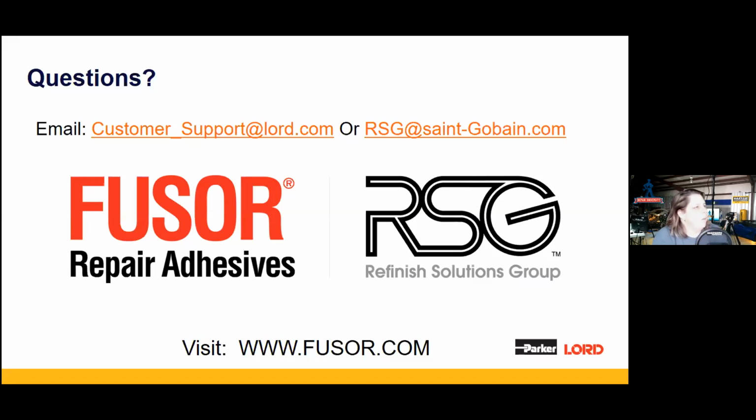And then there's another question in here. Are you aware of any 2K aerosol primers on the market? I am. Spray Max is the only one I know. Yeah, Spray Max kind of leads that market. Eastwood also says they have one. I've just never really seen them effectively used in a collision shop. Spray Max makes an epoxy, and also makes others, but I've just never seen them used.